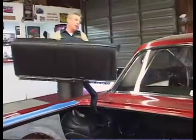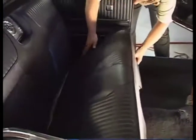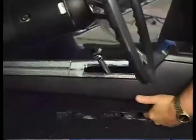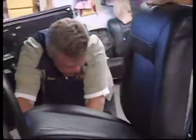When they went to install the rear seat, they had the seat in too high. When you're installing seats in these older cars, you have to start from the bottom and push upward — the top of the seats are always a little narrower than the bottom, so you have to go in from the bottom and push forward. I was very happy to see the interior coming together today because we went through quite a few changes — the vehicle parts came from two or three different vehicles and some of the stuff didn't fit exactly. They may not be an exact fit, but pros like Ray and Wanda resolve problems like that every day.